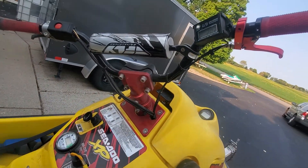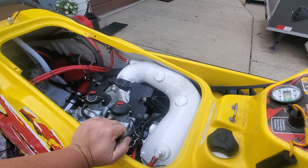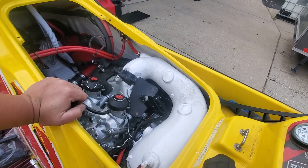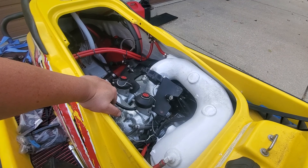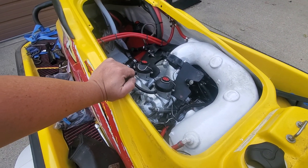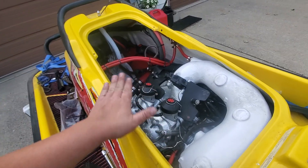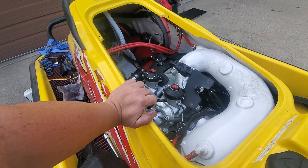As you can see, we're idling a little over 3,000 RPMs out of water. I'll need to monkey with that a little bit as it gets broken in. I wanted to idle about 3,000 RPMs, so we're kind of there, but we'll adjust it a little as she gets worn in. Sounds a lot better and it doesn't do all that shaking it did before.